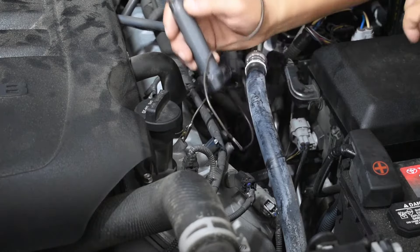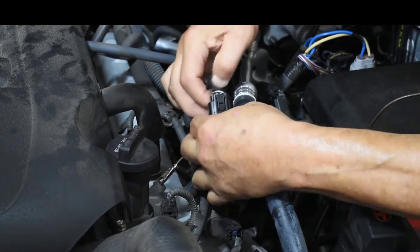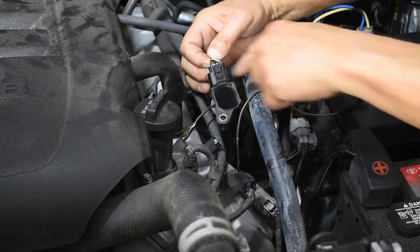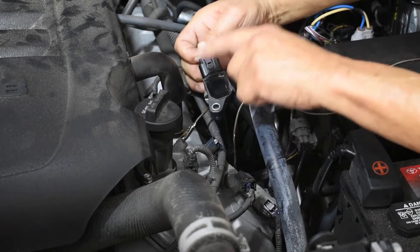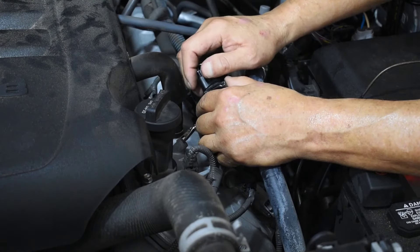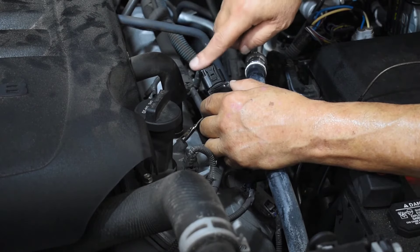There it is — you see the spark? The spark is there. That's a good coil. Engine off. Now, unfortunately, late model coils — some of them have several wires. This one has four wires; some have two, some three, some four. When it has more than two wires, there is a small module inside that makes it a little complicated, but we have a way out. If this coil is not sparking, the best thing to do is swap it — take another one out, put it in its place, and test it. If it works when you switch it, it's the bad coil. If it still doesn't work, you have a problem in the circuit that needs more testing.